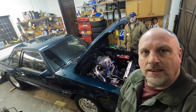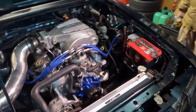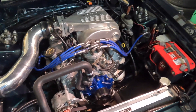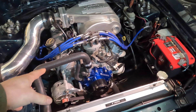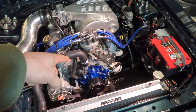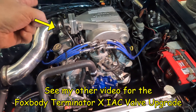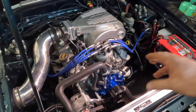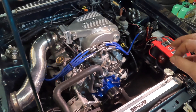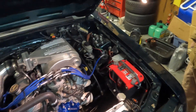Welcome back to Fox's Abroad. This evening we're working on John's car again, on the dyno. He's been driving it around since he got it registered. What we've got going on is when we were on the dyno it was all well and good up to 7,000 RPM. This is a 347 stroker combo with AFR 185 heads, custom FTI hydraulic roller cam, Terminator X, 60-pound injectors, big throttle body, big intake — a lot of good parts. On the street and at the track he was breaking up and misfiring at higher RPMs, like five and a half to six thousand.